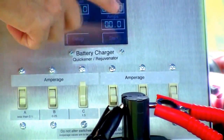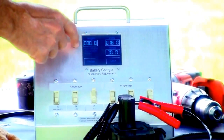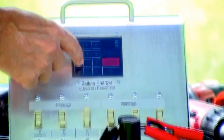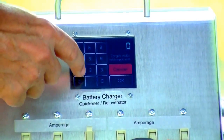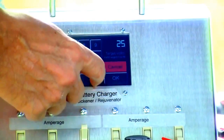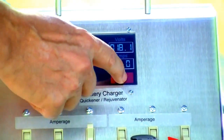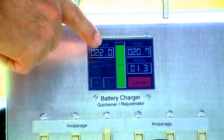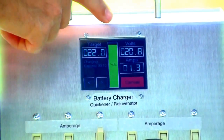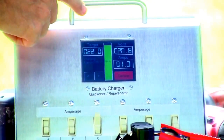All the others are off. It's reading 18 volts. Dead battery was 17.9 — so 18. You want to set the target voltage. Can you read the screen? Okay. Set up, and target voltage. You go about 20% over, so that's about 4 volts — it'll be 22. Clear that. 22 volts. And you hit start. You see it charging. It's at 94% charge right now already. It's at 20.8 volts. 1.3 amps. We'll watch how fast this thing charges.